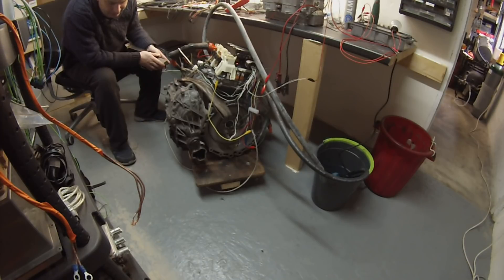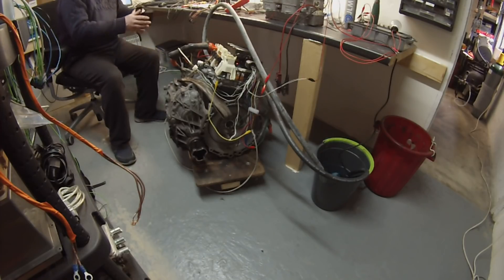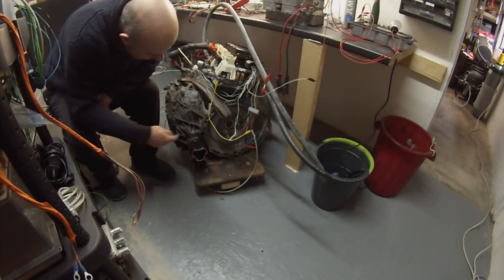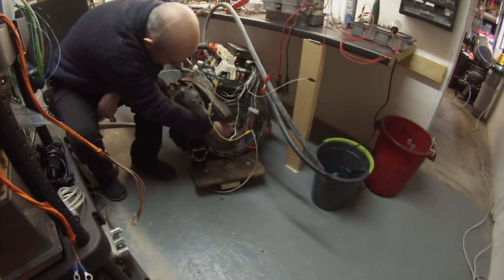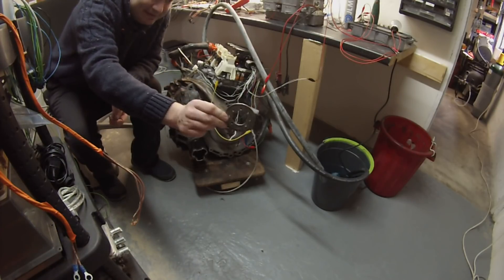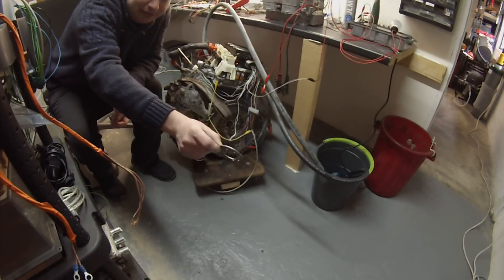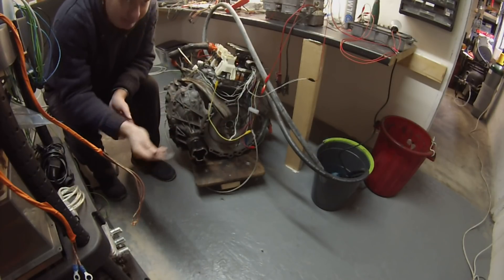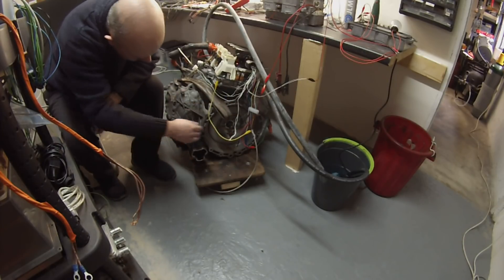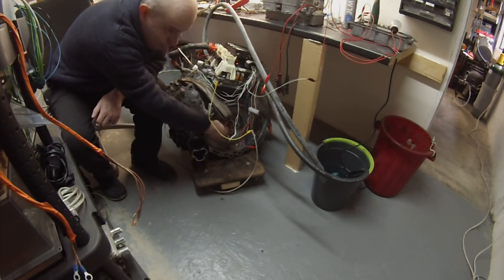Oh no. What's that shaking? Oh no. There's something wrong. There's some kind of weird rattling sound in here. What could that possibly be? Well, the weird rattling sound is being caused by the MG1 stator, because it's shaking in and out by roughly the thickness of this gold-iron piece of metal ring thingy. It turns out that this gold-iron piece of metal ring thingy is designed to regulate the end float of the MG1 stator.